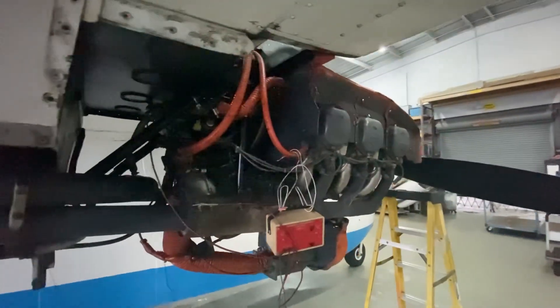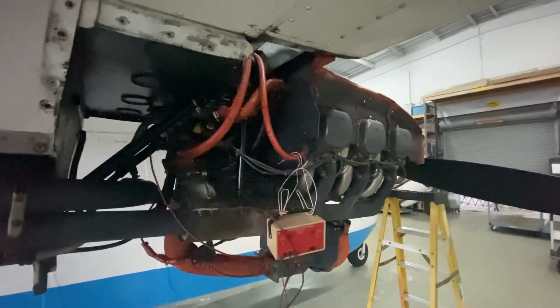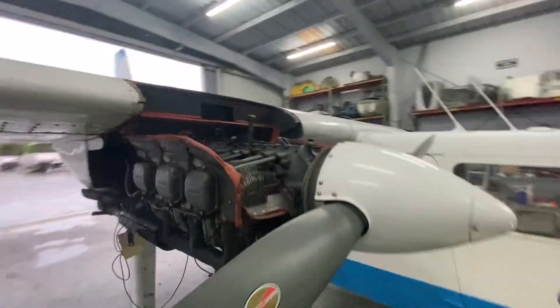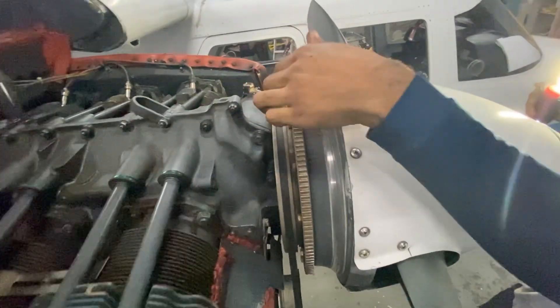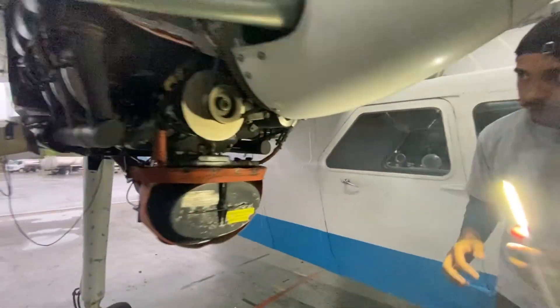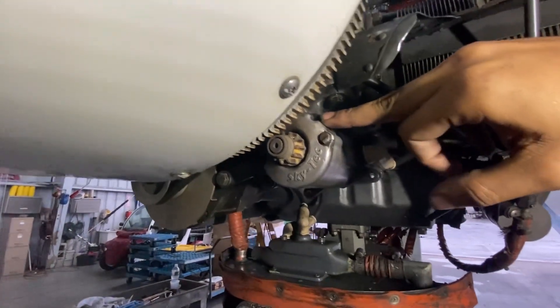You have a degree window mark, and there are two ways to check if it's on the mark. One is with the seam of the case on top — if it lines up with the gear up here, there's a marking there for TDC, top dead center, so 25 and then 20 as windows. If you come on this side where the starter is, there's always a second way to check it — this little hole right here.